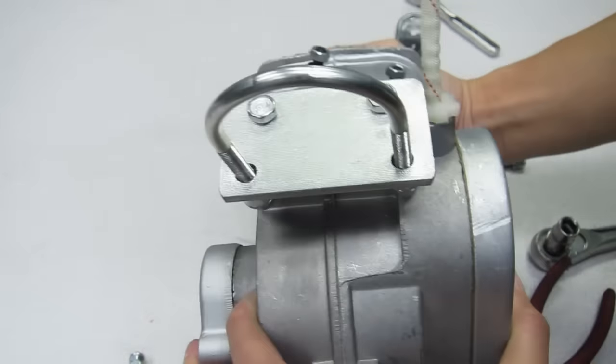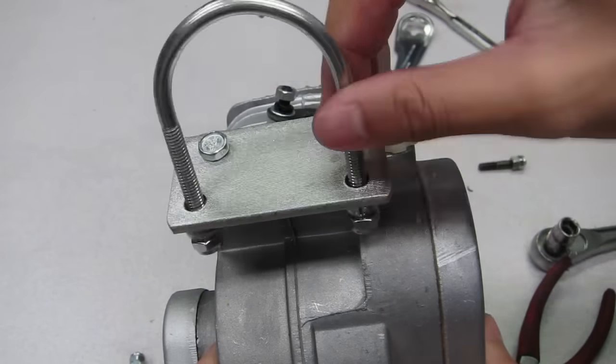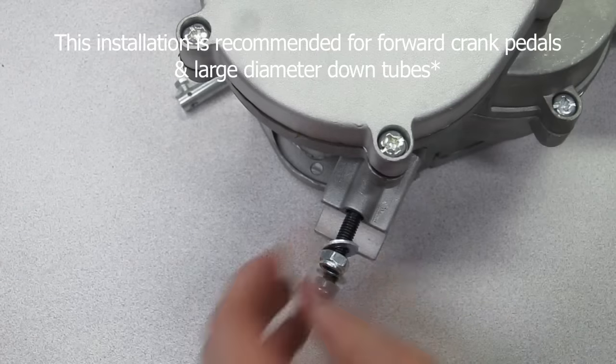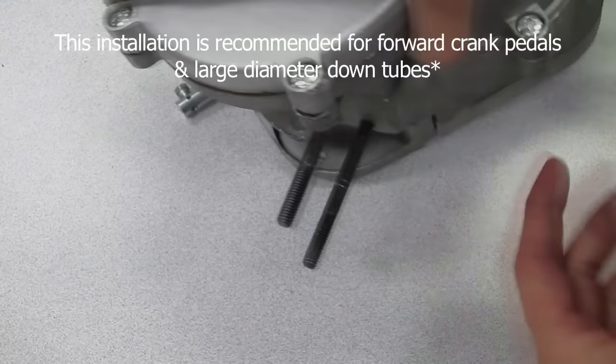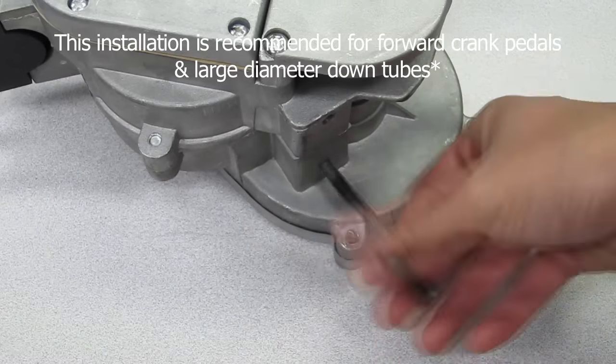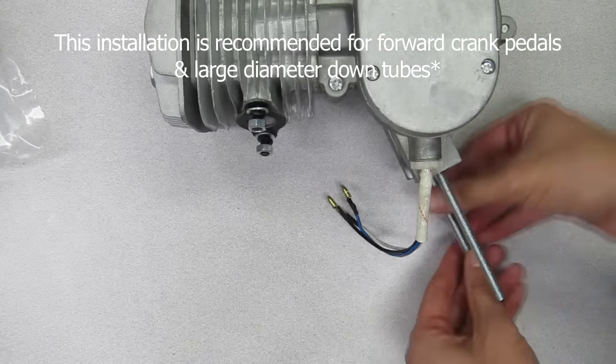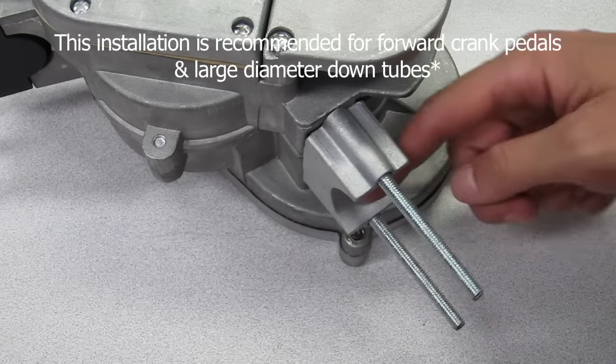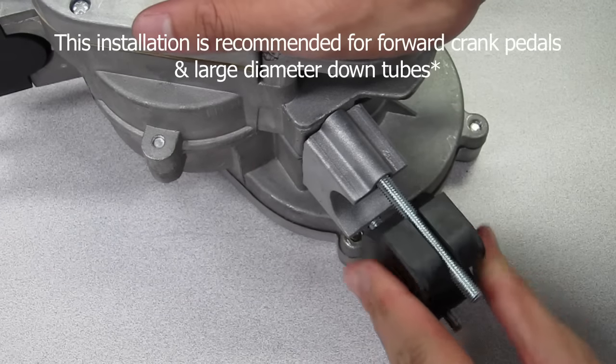If you, however, purchased our DIY engine biking kit combo, most of them include the J&M vibration motor mounts due to the foot pedals on the beach cruisers we carry. To install these, 1. Remove the front and rear mounting studs using the same method as mentioned earlier. 2. Replace them with the extended mounting studs from the kit. 3. Thread the rubber mounts and you're done. Go install it on your bike.